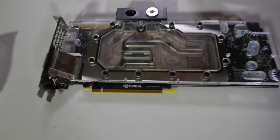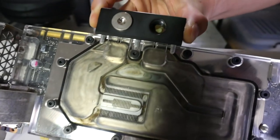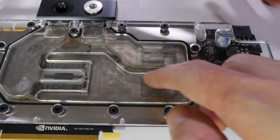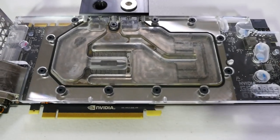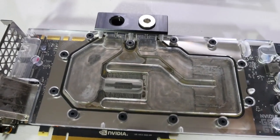So with galvanic corrosion — anode and cathode, negative and positive — that's pretty bad. You end up with buildup in one area and corrosion in another. It takes from one part, corrodes one part, and then it builds up in another. But I think this is probably not purely galvanic — it might be a little bit of galvanic — but I think this is just corrosion that has built up in the fins because it's obviously the tightest part.